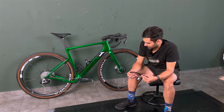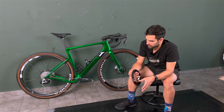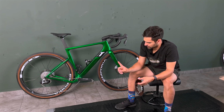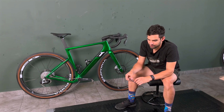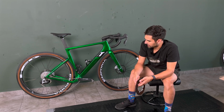Even like this with the classified setup, I would like to go up to the 50 at least for more drivetrain efficiency because of the 46 and the 11-34 tooth cassette and the reduction gear ratio. I don't really have any place in the surrounding area where I could use that low of a gear.